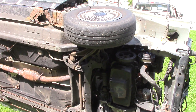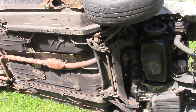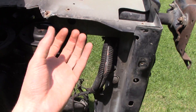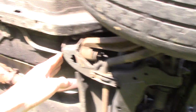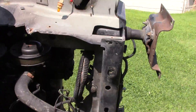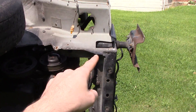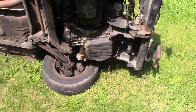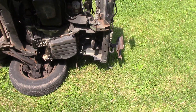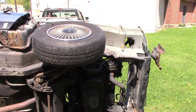Something I really want to note about these cars compared to the Cutlass W-body frame or the '90s Taurus and the '91 Lincoln: all those vehicles have two frames up front — an actual sub-frame that's square-framed, bolted in, running under and bolting to the underbody floor, and then there's the unibody frame which is part of the floor and has the bumper shocks through it. This car does not have two frames; it has no actual sub-frame — it's all one piece unibody. That's one reason these cars are probably weaker for derby because there's just that one factor keeping it straight, and it's much easier to bend.